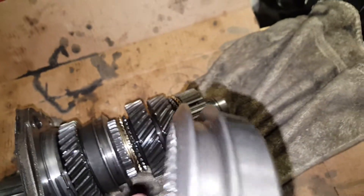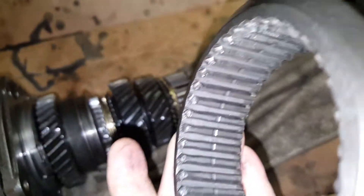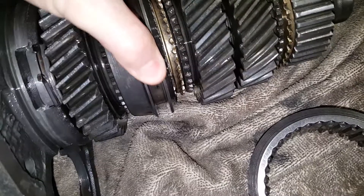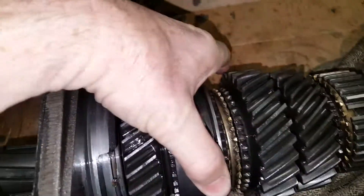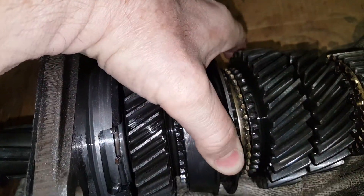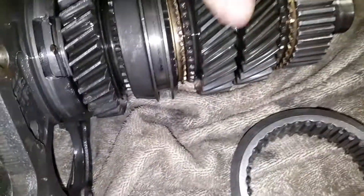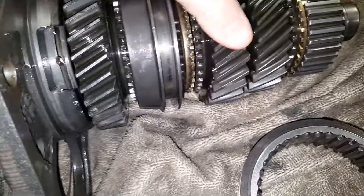This is the side that faced third gear, and this side faced fourth gear — fourth gear is near, it's on the input shaft. Anyway, that hub and that slider coming off were just as sloppy as this one. That's rocking — not sliding back and forth, that's just rocking. And that is curious.